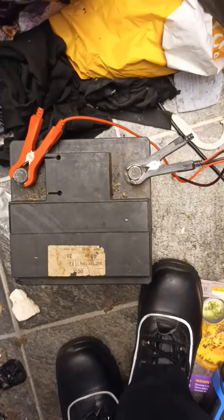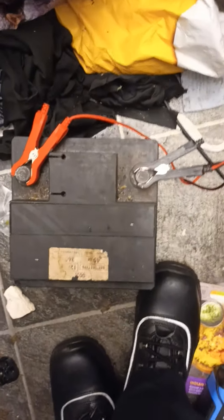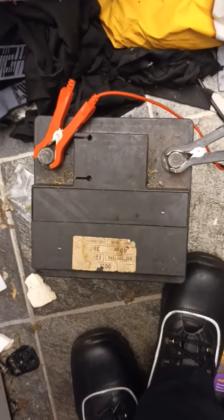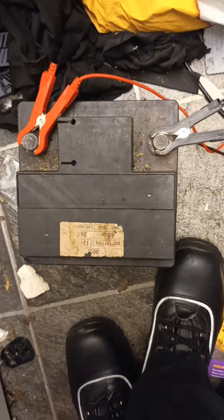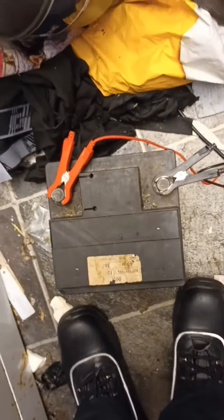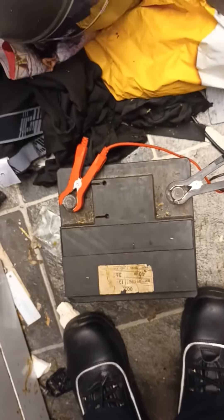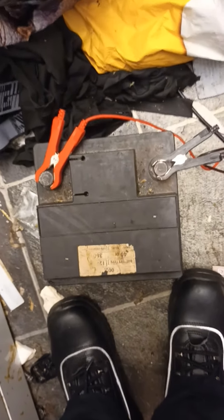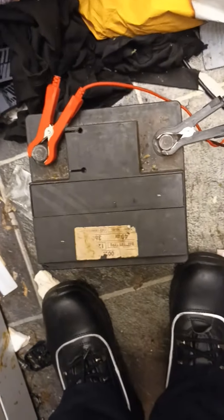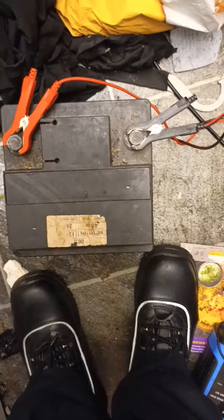It can't be a bad battery, really — it's a new battery. I haven't had it long and I've hardly used it. But obviously, turning the engine over and over, it's flattened it. And of course, I've trashed two sensor units for the petrol gauge. I've got a petrol gauge coming that fastens into the tank. Because the petrol gauge is trashed on both pumps now. So possibly the original pump was fine — it was just a flat battery.